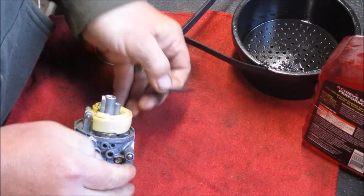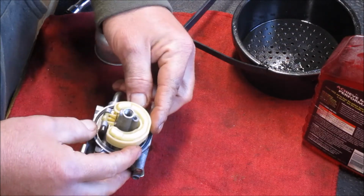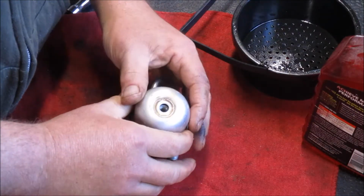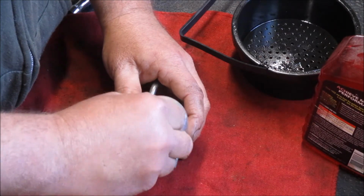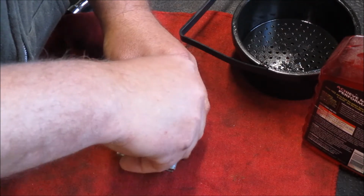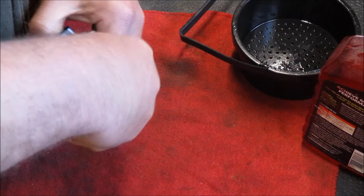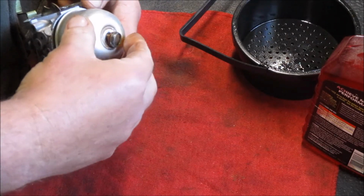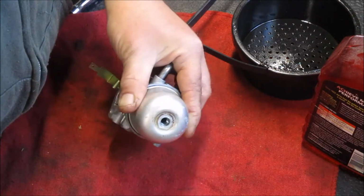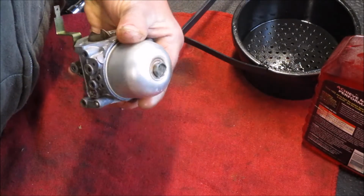And then we're going to try to replace this gasket. You know, we kind of salvaged the gasket. And it looks like it's still going to lie flat, which is good news for us. There's the bowl back on. That gasket still looks okay. The trick here, of course, will be to line the bowl up so it's exactly in its notch, and obviously, oops. So the gasket actually does its work.